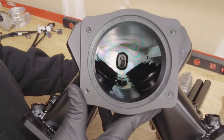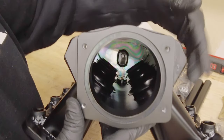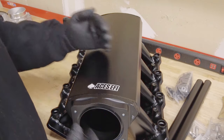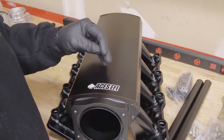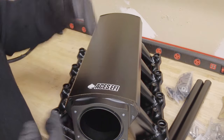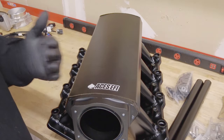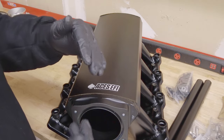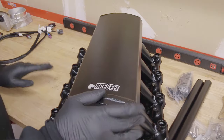Look down the throat — look at that beautiful thing. Nice, long runners. In these long runner styles, when the air velocity gets up, you end up in this inertial supercharging situation. The air gets so much weight and velocity that you can run up until beyond 100% VE. So you get so much airflow and density of air — it'll actually be above our atmosphere and other nerd-related things. So let's get to installing some stuff.